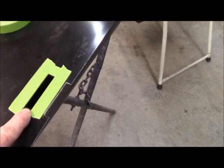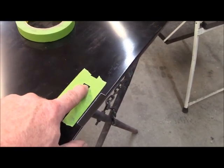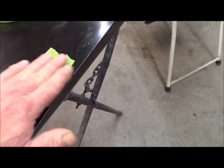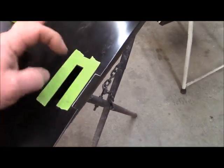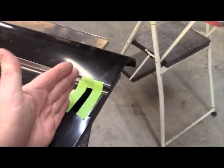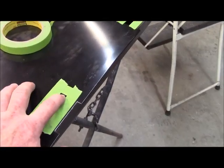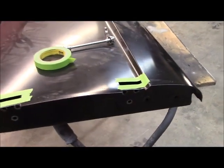I measured the gap right here, masked it off with masking tape up the sides, then I'll go in and cut that little bit out precisely, because this is what you're going to see when you're done with the body work — it'll be a mirror image of that opening on top and bottom. Sometimes I'll line this one up with the hinge too; you can file it to make it line up and look a little better. I know I've got to move this one or it's going to be rubbing on your hinge. I'll do both sides like that.